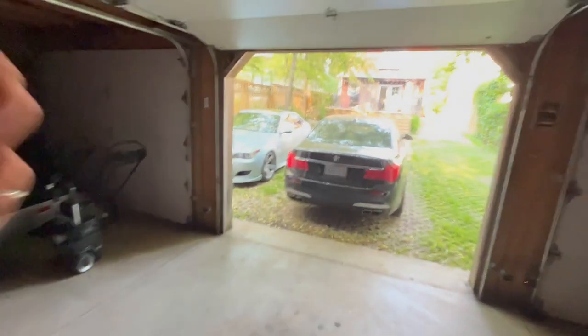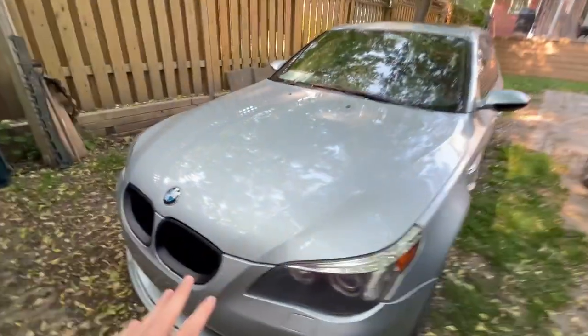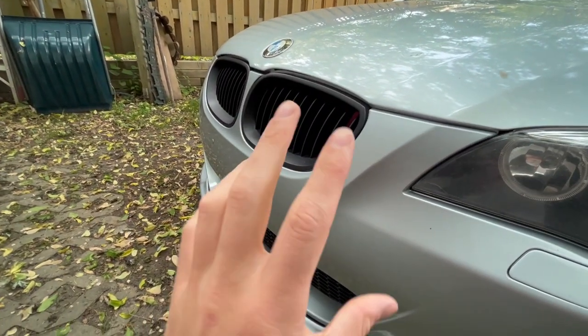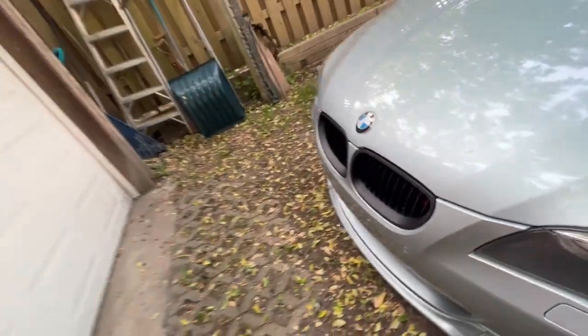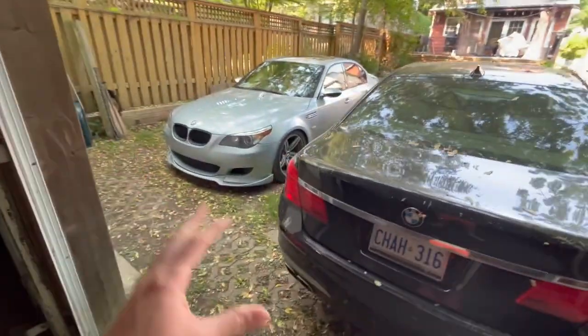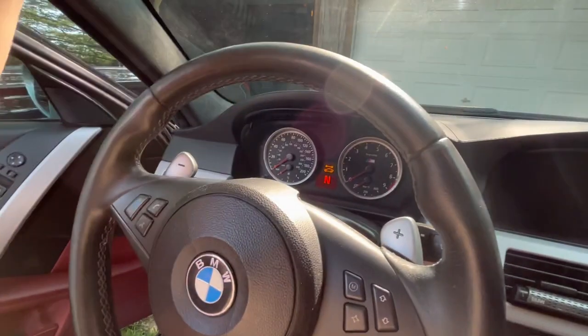A lot of the human day-to-day things you can do with this car is simply not clicking a lot of buttons, not using a lot of the settings, not pushing it too hard before you let the car warm up. The Vano system is already kind of warmed up — it changes tone once it does warm up, it doesn't blow so hard, you don't hear that mechanical screech. After six to eight minutes you know this thing is good to drive. Tip number one, especially with an older car and a V10 engine: let the damn car warm up.